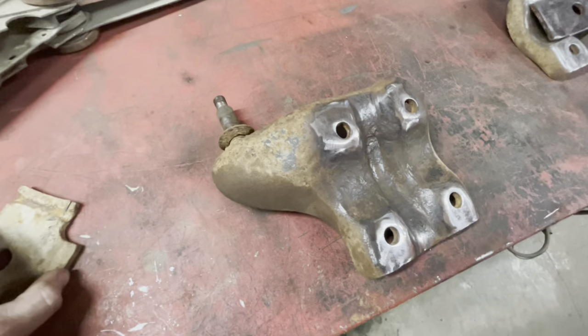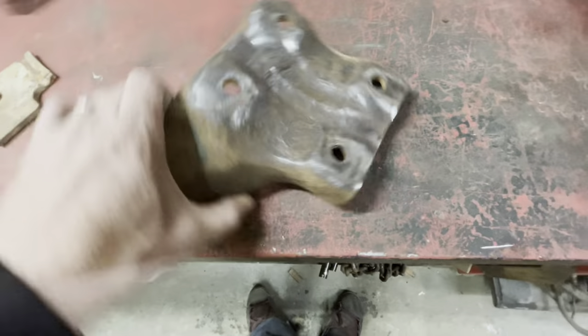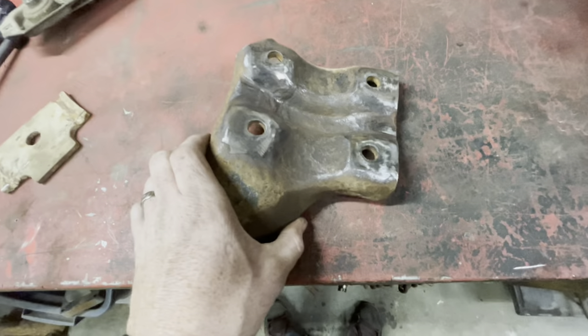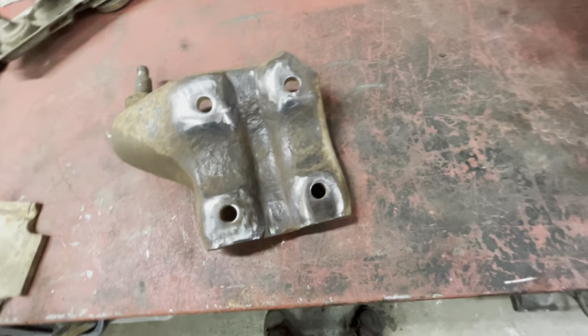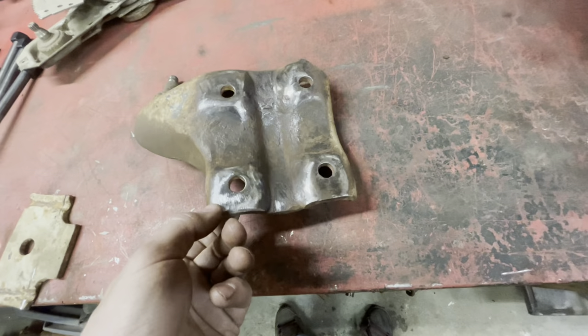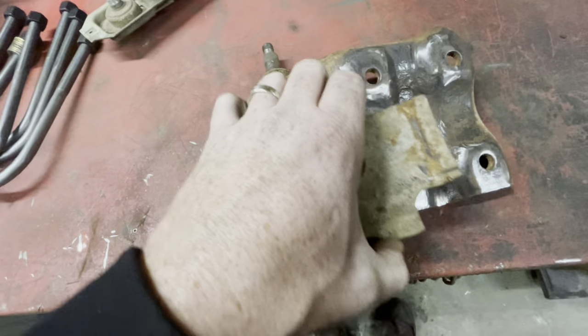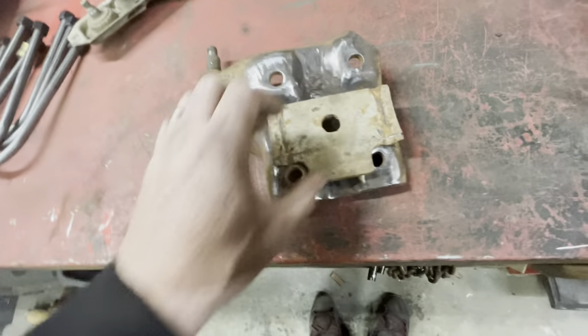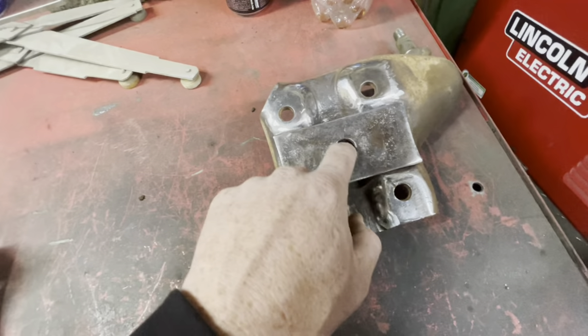Once you get the diff down and unbolted or cut, you've got to get into some prep work. This is how I do it - I reuse the stock shock mounts, the lower plates. Generally the axle tube will sit in here, but now this will be below the spring pack, so you need to have a plate with an alignment hole in it - weld it in here so that when you tighten the u-bolts it keeps it centered. What I usually do is use the top plates that are on the spring pack, cut them down, clean them up and weld them in so you still have the center alignment hole.